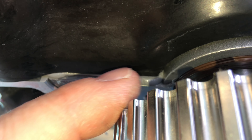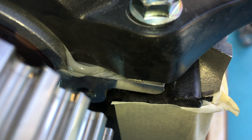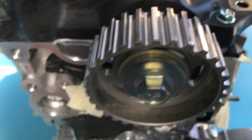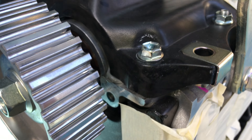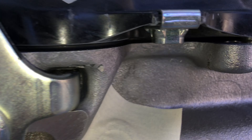You'd go one, two at each side of this hump here, and one little dob at that bottom corner there as well. Nowhere else on this valve cover is there, or should there be, any RTV silicone. And yes, that gap is normal because it is what's required - you can see the crush tube.